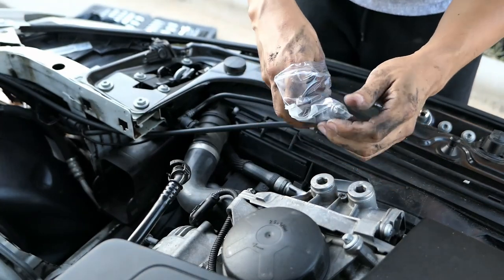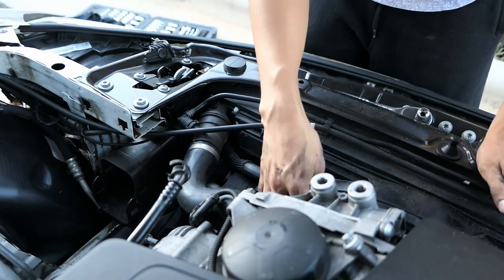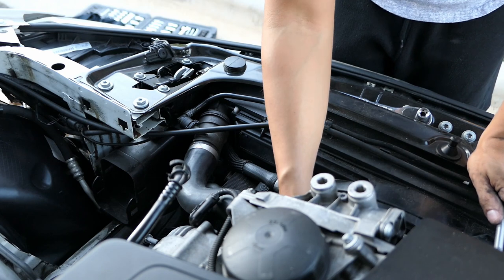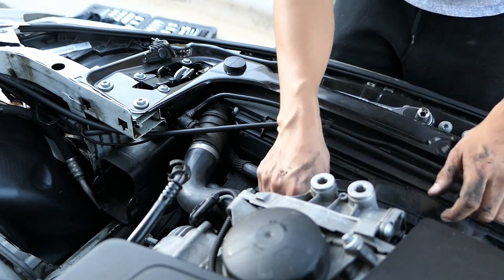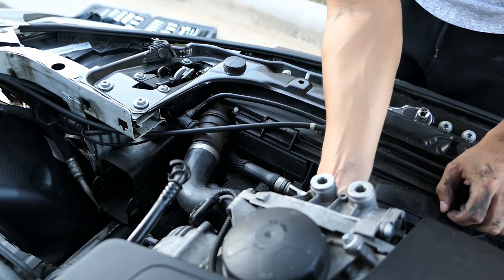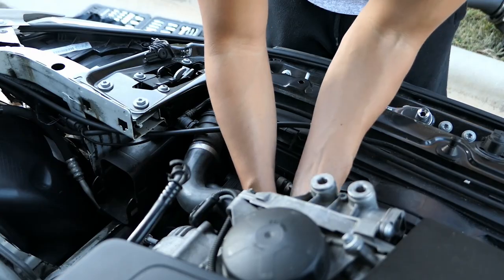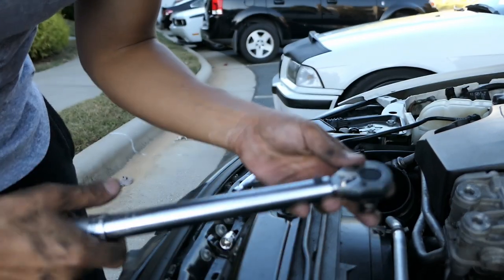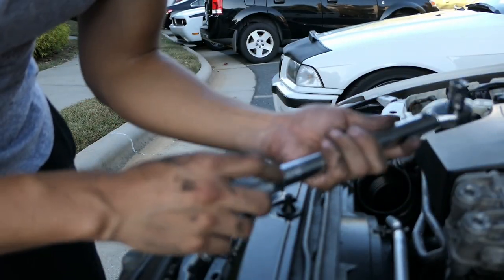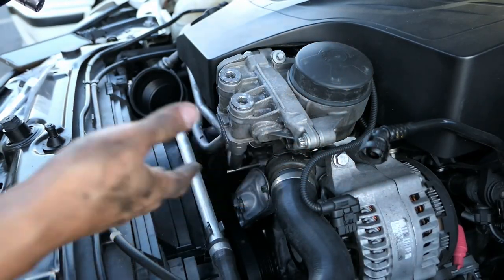Here's the new bolt — it comes with the washer. The tensioner can only go in one way, so just feed it in and once you place it inside you'll feel it go into its groove. The E14 was actually almost perfect. I have the torque wrench set to 28 foot-pounds. We got it torqued down.